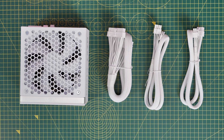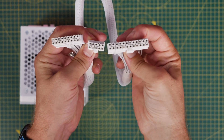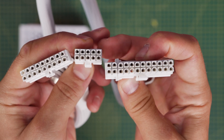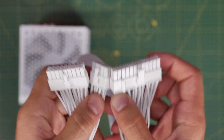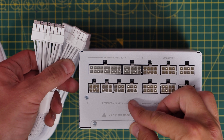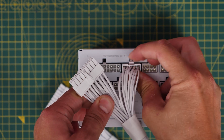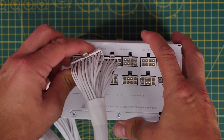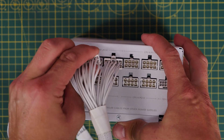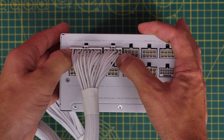We're going to start with the motherboard power cables — this large 24-pin and then two marked CPU, which we'll get to in a second. The 24-pin power cable is split into two parts on the power supply end, which you can see in my left hand there, and then the other end will plug into the motherboard. You're looking for the 'Motherboard 20+4' port in the top left of the power supply — push those cables in. With all the power supply cables, it's really important to make sure these are pushed all the way in until they click into place.